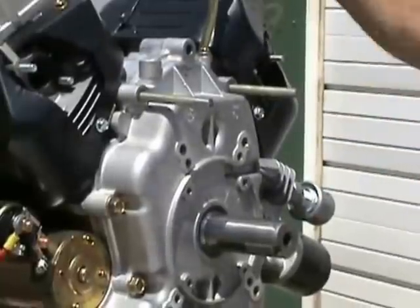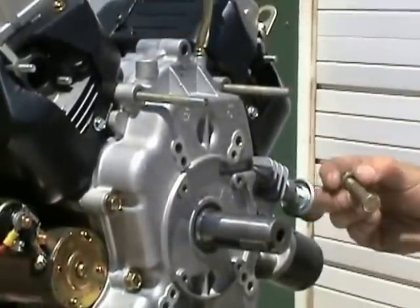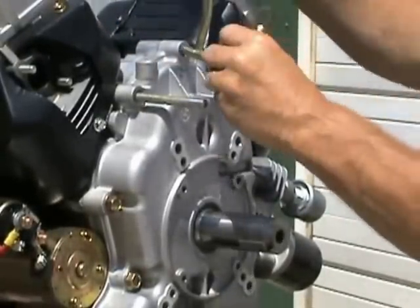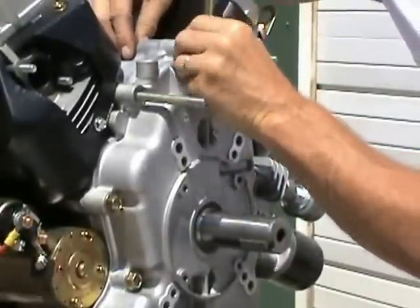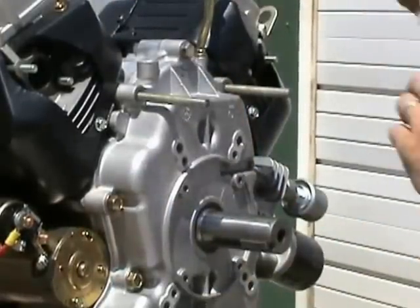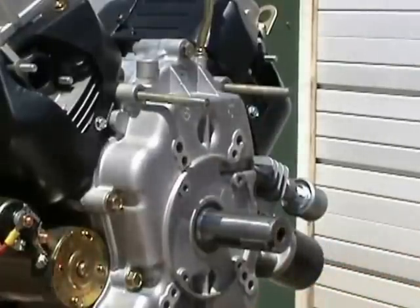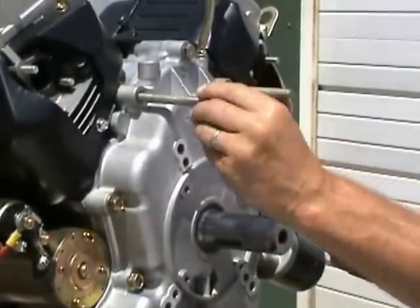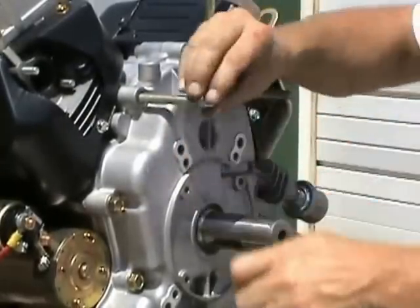On our installations, normally we use this as a mounting attachment, so you'll have to fix your own to go in there to mount your engine mount to. But for this application today, you don't want to leave that open for sure. Go ahead and put a bolt in there and tighten it down. If you have a bed mount and don't use it, you'll need to install the bolt and tighten it. Two of your nuts in your set are non-locking — you'll use those to run your studs down with.